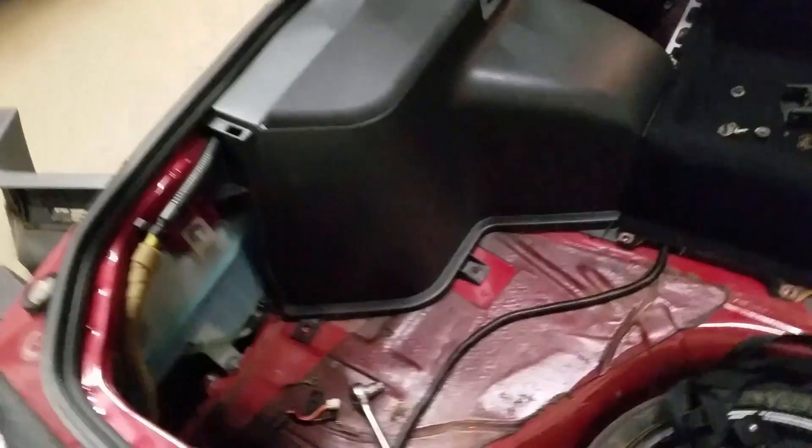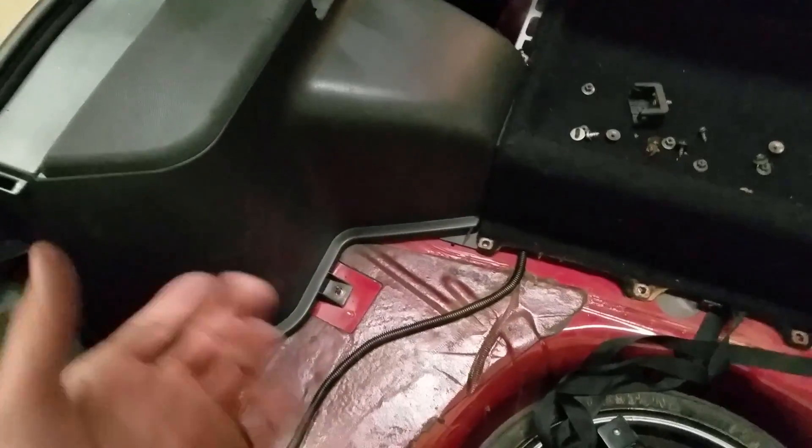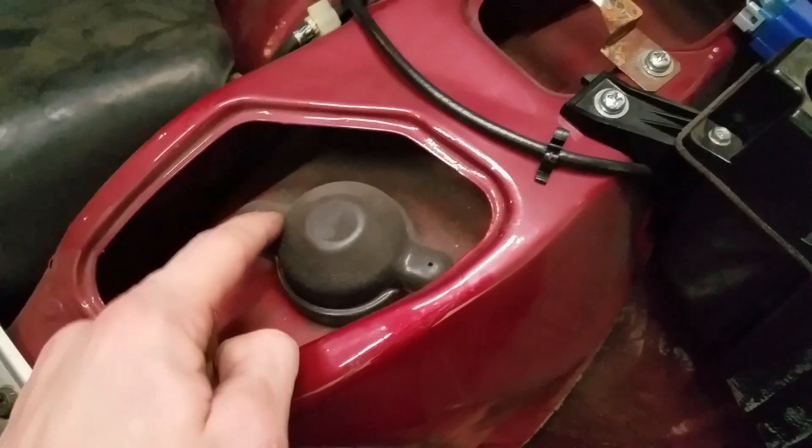All right guys, so I'm starting to take off everything out of the back. Since it's OEM, everything is bone stock in here. All you have to do is take off literally every single piece of plastic in the back — there are going to be bolts all around, so don't start pulling on stuff because you might break the tabs off. Start from the center piece, work on over — there'll be bolts right here, bolts down here around, and then more bolts on this side closer to the driver's seat. Take those out, pop it off, and there's our strut — just two bolts, bang, all set.